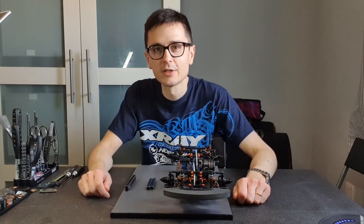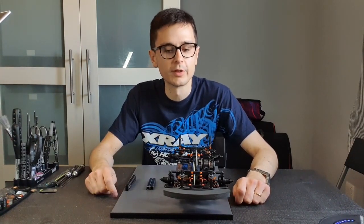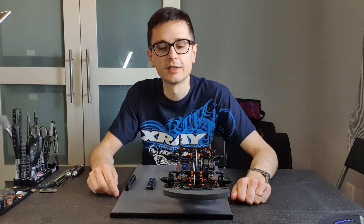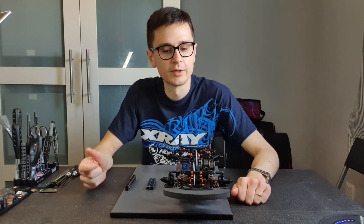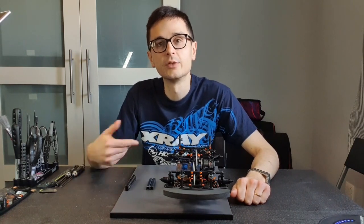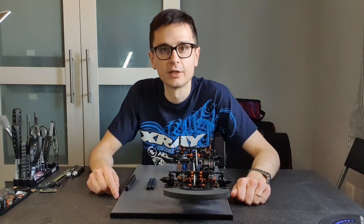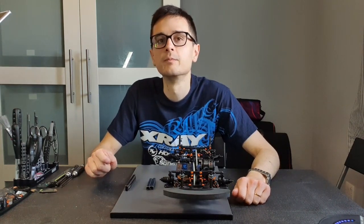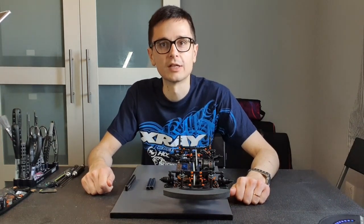What about the value in the front? Sometimes it's better to leave the rear value alone and play with the front value instead. For example, at a track with a lot of chicanes or fast direction changes, you want to make sure the front doesn't roll too much because it will help maintain stability. If there are many chicanes or you need the car to be more stable on throttle, decrease the front droop — go to a higher downstop value in the front. This will help the car stay flatter over the front. Through those chicanes it won't roll as much and you'll be able to use more throttle, gaining a lot of time.